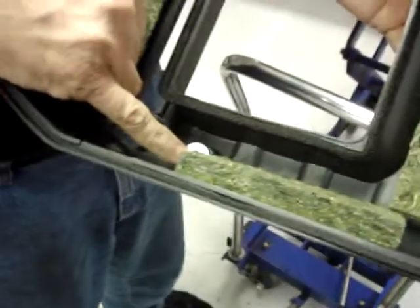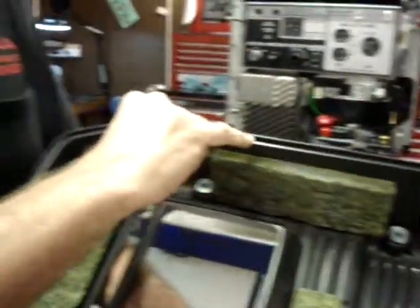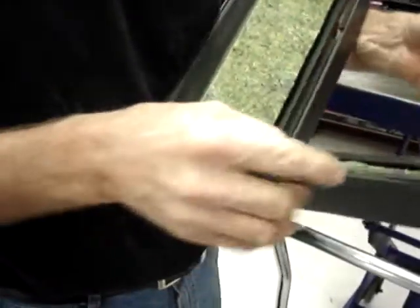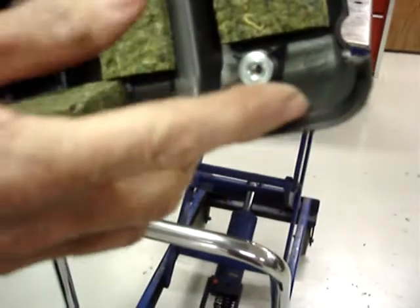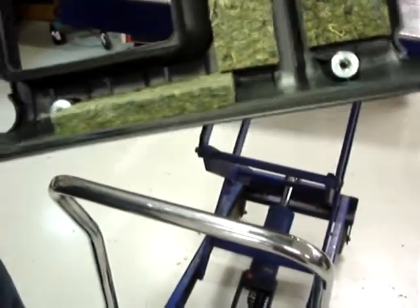Check to make sure that your four metal spacers are still in place, and they are. And then check the foam gasket that goes into this groove. It has started to come out at the top, and it has come completely out at this side. So we simply push it back into the groove, just a little bit of light fingertip pressure. And we'll set the front cover aside.